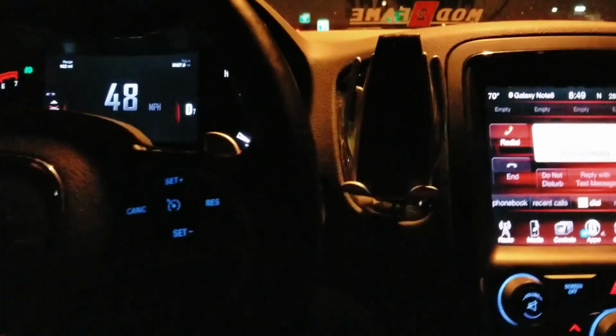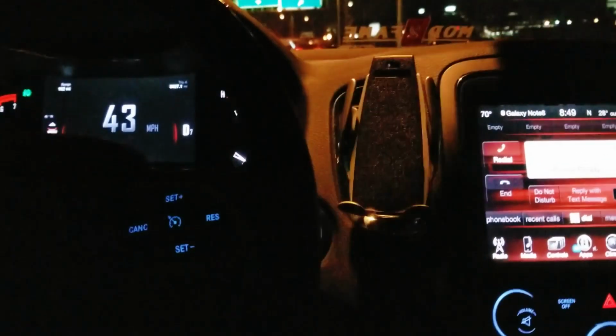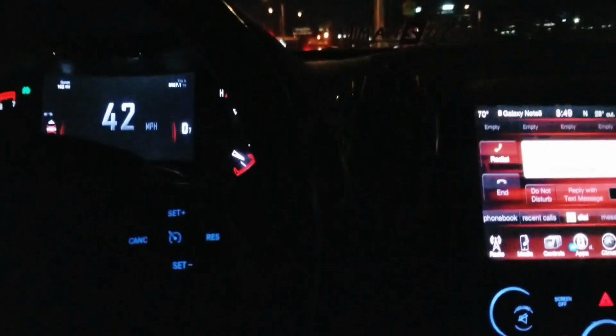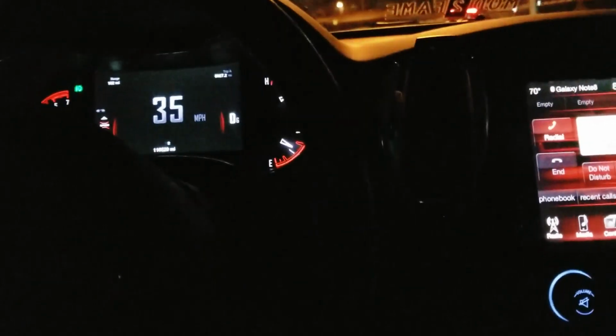What I'm gonna do is burn this gas down to like a 1/4 tank. I'm gonna add in 2 gallons of 100 octane to make sure that it's 93, because it's winter blends right now. To make sure that it's 93, I'm gonna load the 93 tune, drive around a little bit, and then we're gonna run this test again. But that'll be in a later video, man.